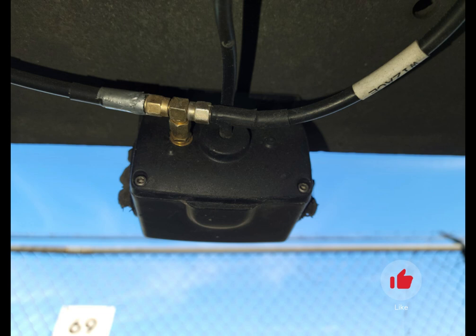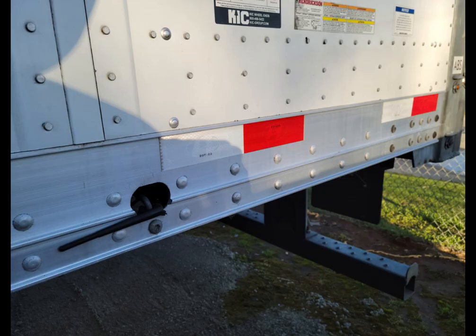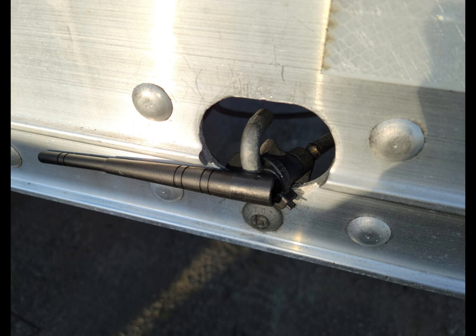The wire in the middle is the power and I tapped off of the license plate light. This means that you have to have the lights on in order for the cameras to work for both cameras. You'll notice the two wires on each side — those are the camera extender wires. I will have a list of all the parts and links in the description so you can get them from Amazon. This is the antenna on the left side sticking out, and here's a close-up — I wire-tied it to the side of the hook so it would be out of the way.